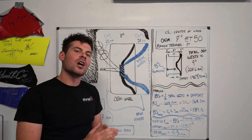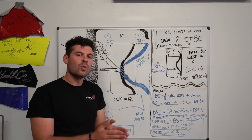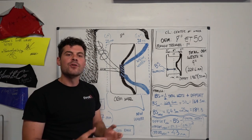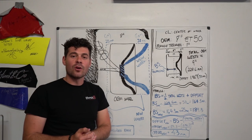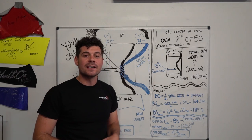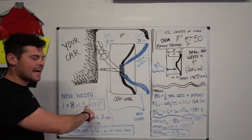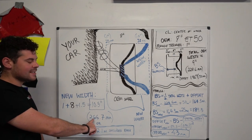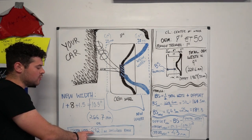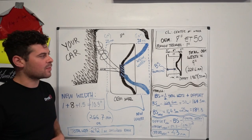The approximate thickness of that flange is about half an inch on each side. So if you were to measure the total wheel width by grabbing a wheel and measuring the overall width, subtract 1 inch and that is the spec that's going to be listed on the part listing. So this wheel is 10.5 inches wide, which is 266.7 millimeters, and if you add the flange thickness, it increases to 292.1 millimeters including the flange.